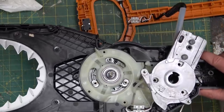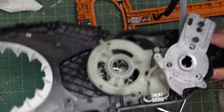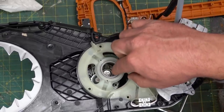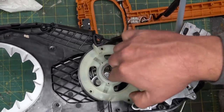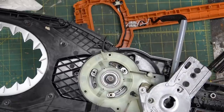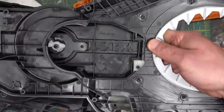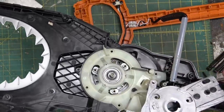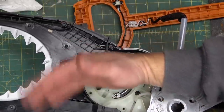So because this has to move back and fro, what they've done is they've added a sintered steel bushing. Not a stitch of lubricating oil on there. Nothing. You hear that? So that, yeah, it's only on the one side, of course, because on this side you need access to the blade tensioning mechanism. So that is the whole and totality of the pivoting mechanism.